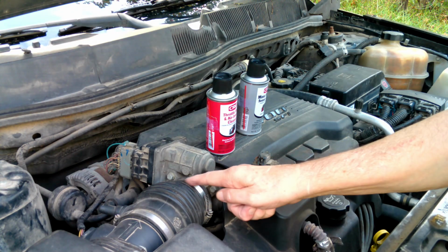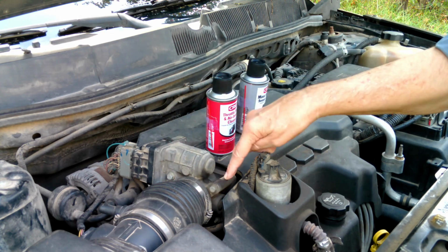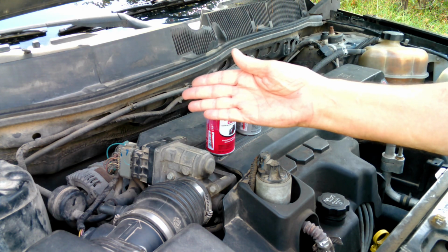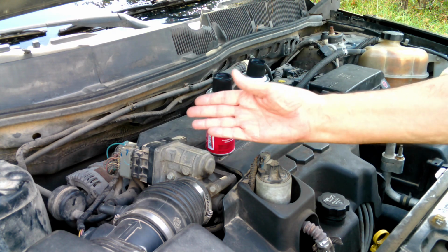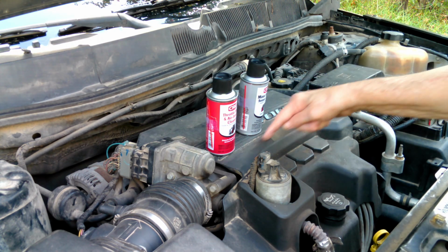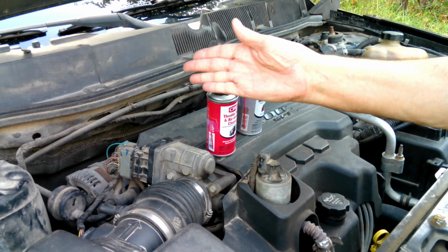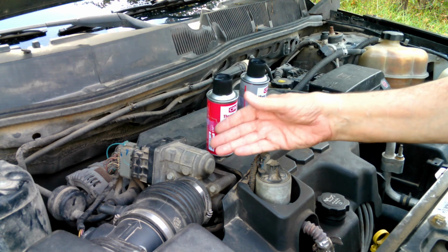This hose that connects the airflow sensor goes into the throttle body assembly. That's this right here. This is the throttle body. This is the famous little flap valve that, you see it on the top of carburetors, if you've ever looked in those all your life. And the little valve that goes like that, that allows air to come in and join your fuel mixture in the manifold, which you can't see. It's under this plastic cover. So that's all this is. Throttle body, it regulates the air coming in. The more air, the faster you go, along with increased fuel flow and a few other things.